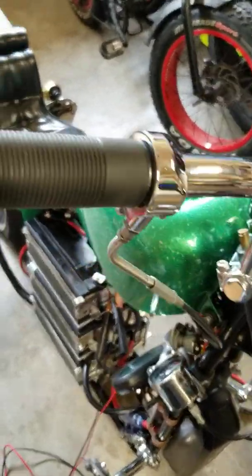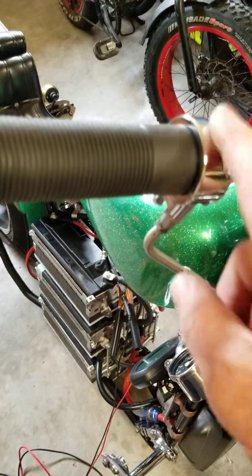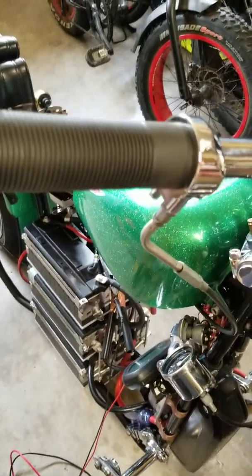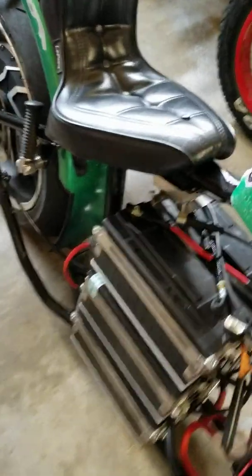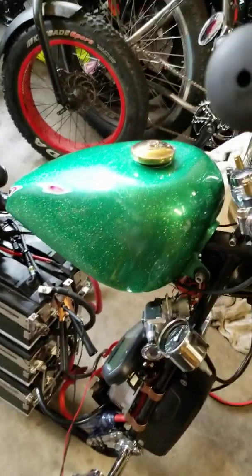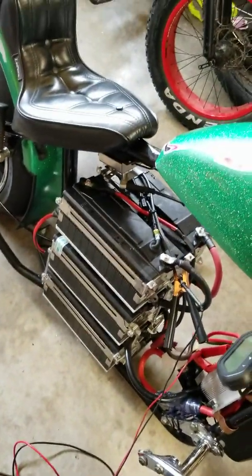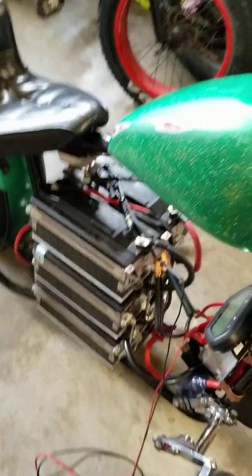For those who tuned in before, I had a hack-job throttle — an e-bike throttle forced to work as a twist throttle on my one-inch bar. It worked but was really sketchy. So I found a potentiometer pot-box throttle in the States for around $50, gutted it, and installed a mechanical throttle assembly — the exact same type I had in my S&S iron — giving killer snap and reaction just like a regular throttle.